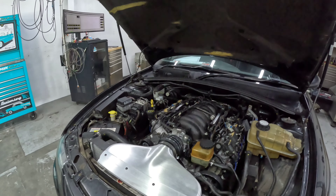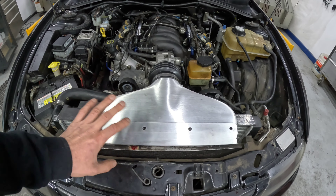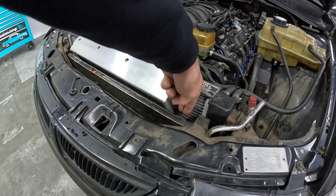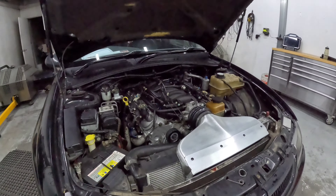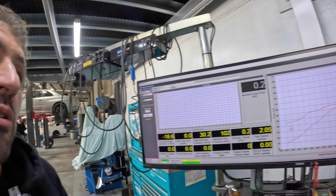A couple of other things with the VT to note: with the aluminium OTR, this is all you can use in this model. You cannot use the plastic VCM one that goes down through here and in front of the radiator — the positioning of the radiator and AC makes that an issue. If you don't have the AC you can definitely use it, but in this case you can't. So if you have a VT and want to put an OTR on it, you need to go with the aluminium VCM one. We do have them on our online store and in the shop.